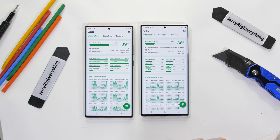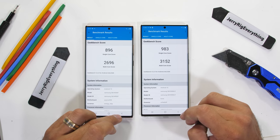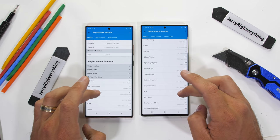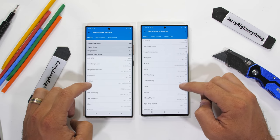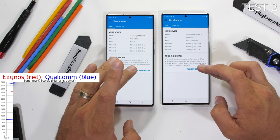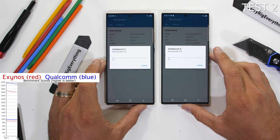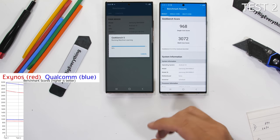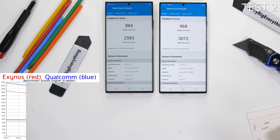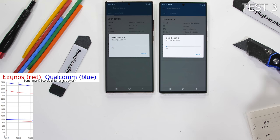I'll keep track of the temperature throughout this process as well. I did try monitoring it through the internal app and all of the temperatures matched up between both devices pretty evenly — Qualcomm did always run a few degrees cooler, but that's not a huge difference. I also measured the temperatures externally throughout the test. A hotter phone doesn't always necessarily mean the processor itself is hotter; it could just mean that the cooling system is actually doing its job of pulling heat away from the processor and pushing it to the outside of the phone.